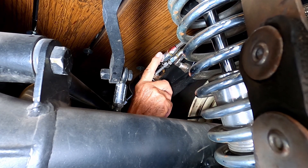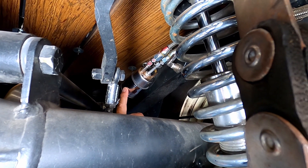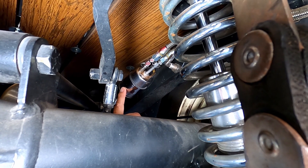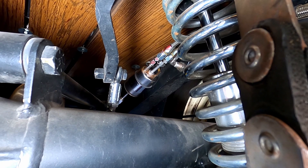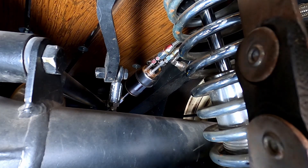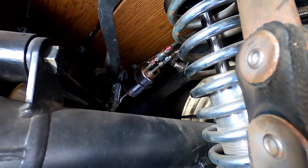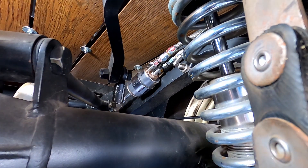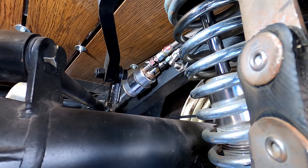The pressure line is on the outside. I had to replace mine because I wasn't getting the right fuel pressure for the engine to start and run. The fuel pressure was about 5 pounds when I was cranking, and finally I got it started and it was running at about 17 pounds. Being as this is an LS engine, it should have been 58 pounds.